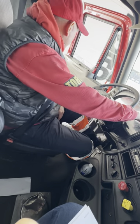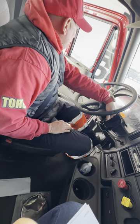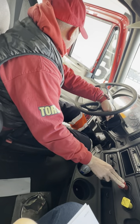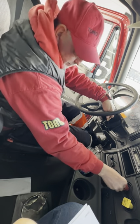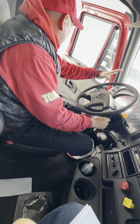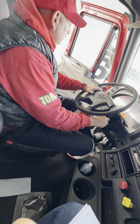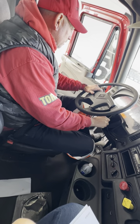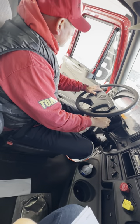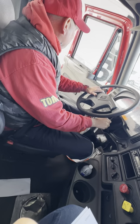Next is going to be my trailer brake. I'm going to put my hand through the steering wheel, pull down on my trailer brake, and push in my emergency brake. I'm going to take my other hand and put it back down on the trailer brake and put my other hand on the steering wheel. I repeat the process — release the clutch slowly, get that tug of vibration, push back in my clutch. That tug of vibration indicates that my trailer brake is working properly.